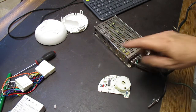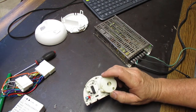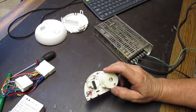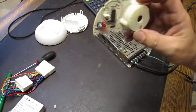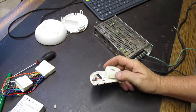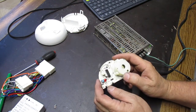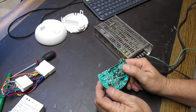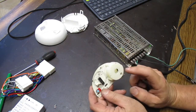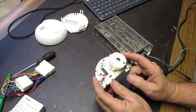So you don't even need any of the smoke. In fact, it's better to take it off, because one, it radiates radiation, which I'm sure is not a lot, but if you install this right above your head, you don't want it radiating on your head. And two, it just takes up a lot more space, so you remove it. But you do need the chip to work, because the chip is the one that controls the speaker. It makes it beep, it does the right frequency.